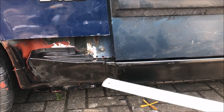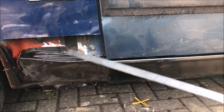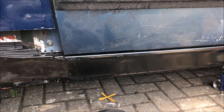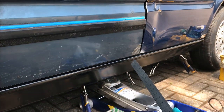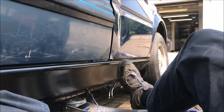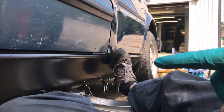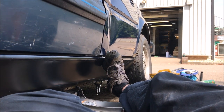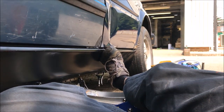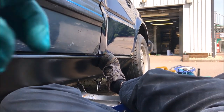I've done the first scary bit — a tack up here, one down there, just to hold the leading edge of the sill. I'm happy that's the right height. Fits really nicely in there, gives me a nice tight gap. On the other side of the car I was measuring anywhere between five and eight mil. The gap is slightly more here, but I discovered that because I unpicked the B pillar, the whole thing is free to move. If you push it there, I'm actually pushing the sill and the B pillar together so all the gaps close up. I've got to find a way of holding that in position while the jack holds the sill up.